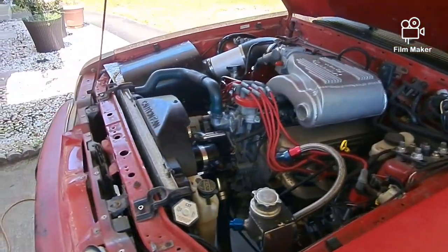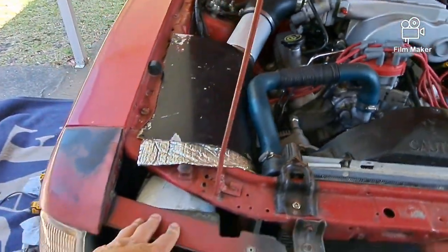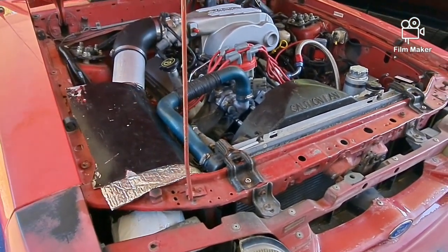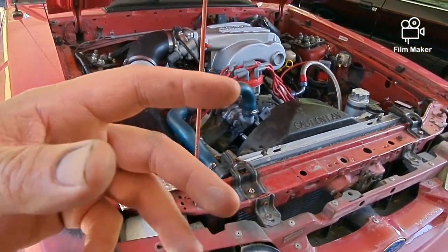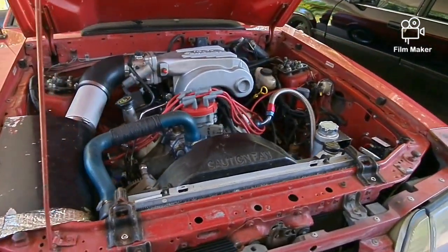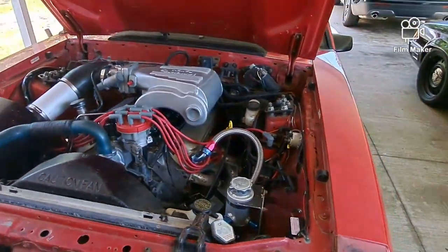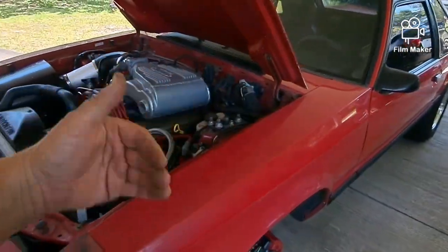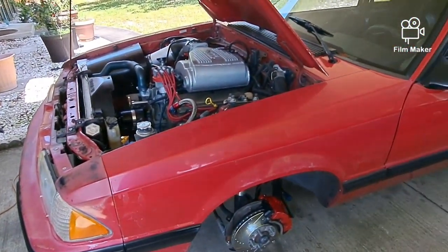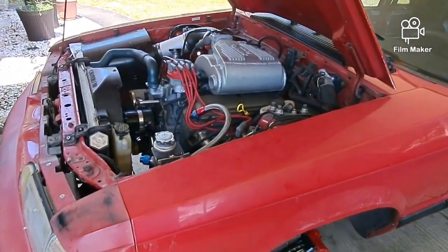I also cleaned the mass air meter. I have a 92 millimeter Pro-M, and if any of you have seen them, they're a 2-piece unit, kind of like the 80 millimeter Pro-M. But it had some oil down in the bottom between the 2 halves, because I was having a hard time when it was cold or not quite up to temperature. Through the mid-range, it had a little flat spot where it was kind of lean, and I could never figure out why. So then I finally took the meter apart and I got that cured. It runs a whole lot better.